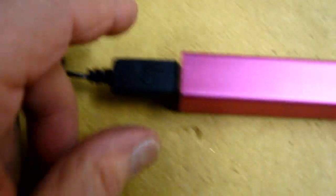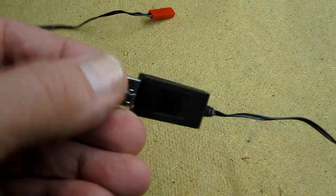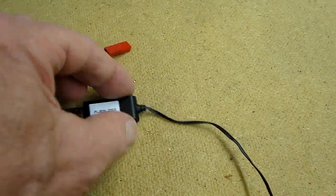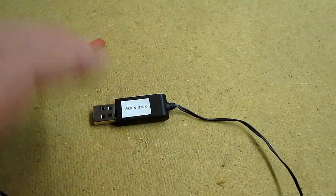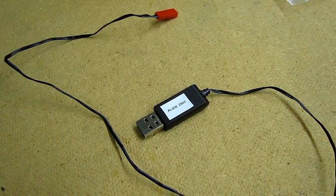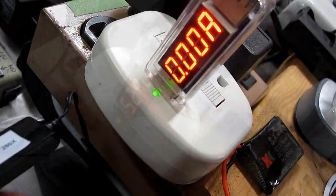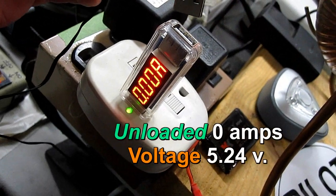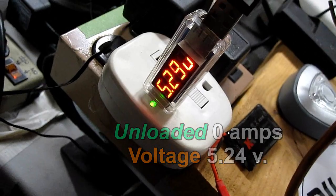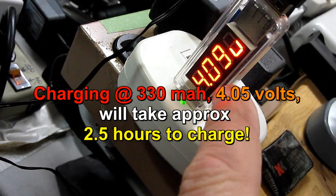For both of these chargers, when the red light comes on that means it's fully charged. Don't expect a lot out of the stock charger because you've got to have the proper voltage and amperage in for this to work right. If any of your machines charge via 5-volt USB, you might be surprised to find out what they're really putting out — my best 5-volt supplies are 500 milliamp max. At 5.2 volts and zero amps, I'm going to plug in the stock charger for the Alien X250 and see what kind of charge rate we're getting. It's charging at 0.35 amps.